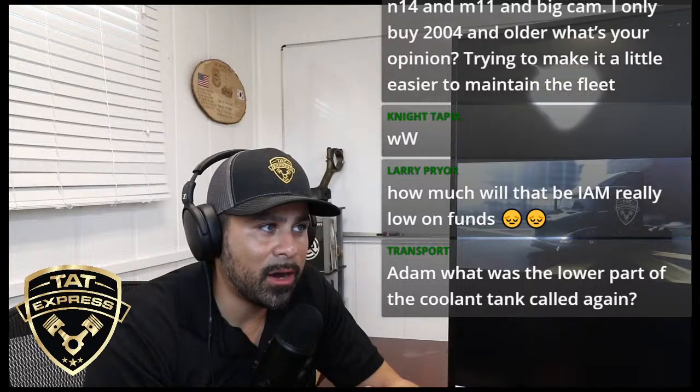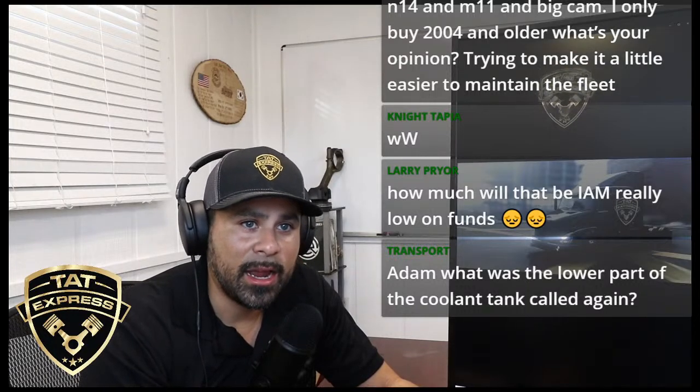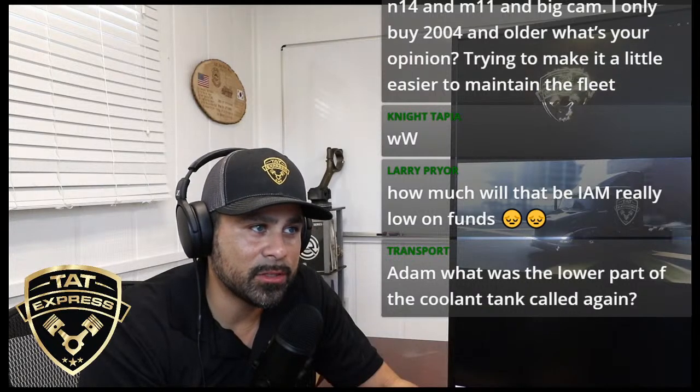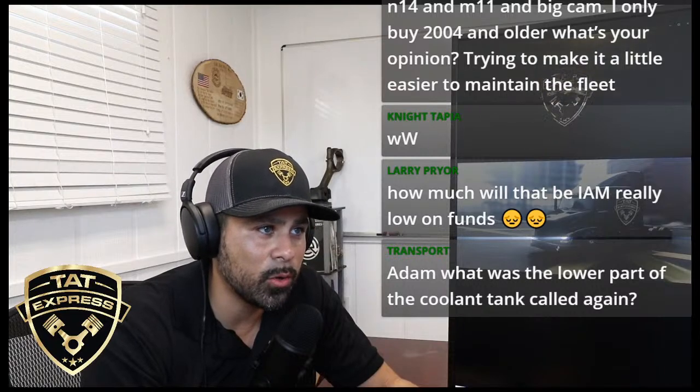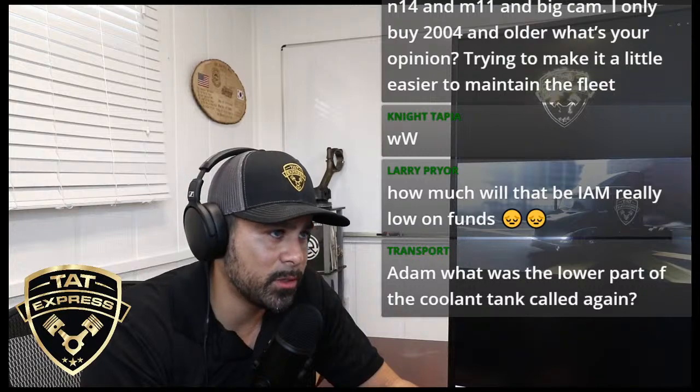If you have high mileage over 400K, yes, you can have corroded EGRs. As I mentioned, corrosion can happen internally if you're not taking care of your coolant, checking your coolant every PM, making sure your nitrite levels, your pH levels, your freeze points are all good.